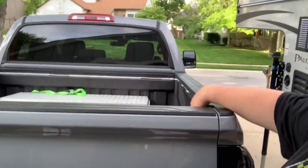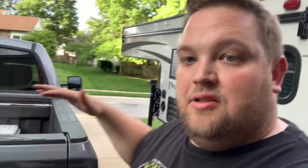Originally I've been using the Brophy over-the-cab brackets that go just over the sides, which I'm still going to be using in the front. But the way they were looking on our truck originally, because the camper is longer than the truck bed, the tie-down points on the cab were so far up that the chain was coming at an angle. So when we were up in the bed of our camper, it felt like it could tip forward. So I decided to spend the money and get the frame-mounted brackets that we're installing that go right on the hitch of the truck.